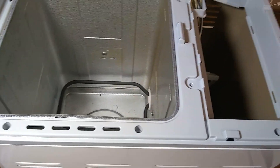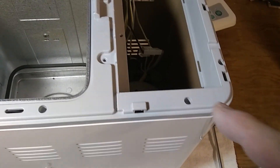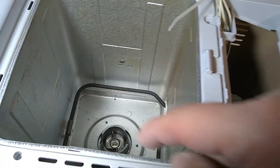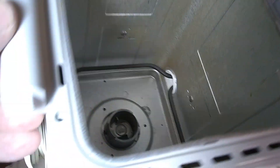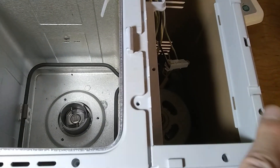When opening the bread maker, you'll find that some of the screws are stainless steel and some are regular steel. These four screws are regular steel, and the remaining ones around the edge will be stainless, as are the three in the bottom. You don't have to unscrew the side ones or the ones that hold the cable winding holder — those stay in place. But you do have to remove the ones around here; they are stainless and not magnetic. The regular steel ones are magnetic, so you can use a magnetic screwdriver.